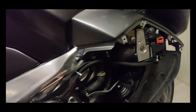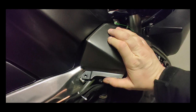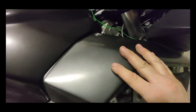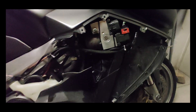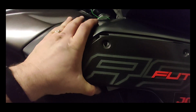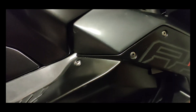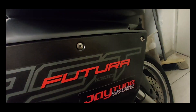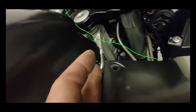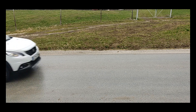Re-assembly showed that the fairings are quite a bit under strain because the ABS unit is not that small and there is actually not a lot of space under the shell. So with some additional trimming, I managed to get things together somehow. The lines on the left and right are not so different considering that the tank is also under some tension because of the rear brake line on the left. These things will have to be taken care of, but they are good enough for a first real road test with a complete bike.